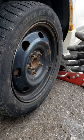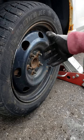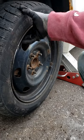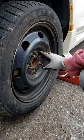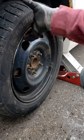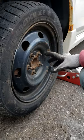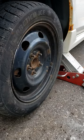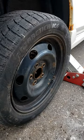Now you want to take off your wheel and change it — maybe you're putting a spare tire on, or another rim. These are winters; maybe you're putting a summer on. This wheel is stuck because they get corroded behind here and can get frozen on there. If it's not coming off, don't stick your arms in and try to pull. Just give it a good kick around the top here — and they'll usually come off.